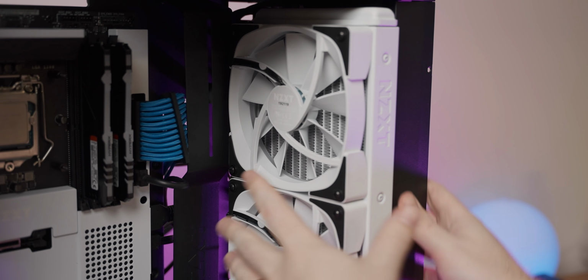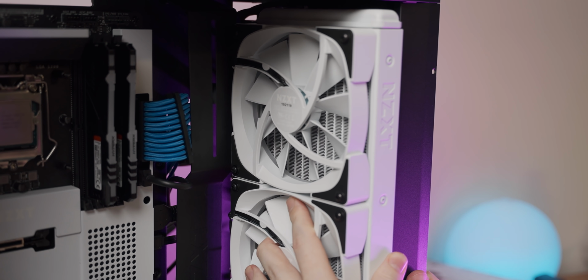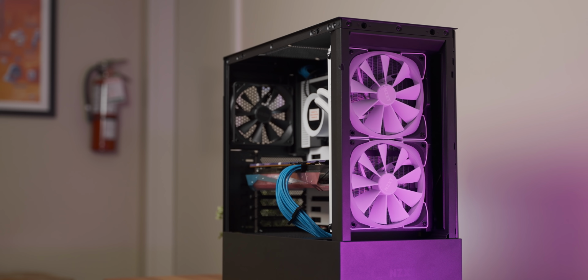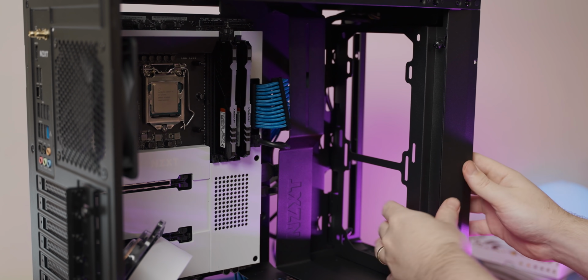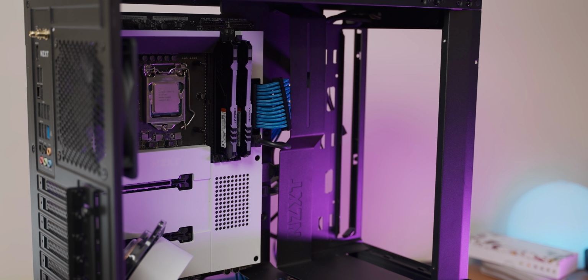and it makes it difficult to maneuver in. And if you have the fans on the same side of the mounting bracket as the radiator, then it's not going to fit in, so you need to move it to the front. On the note of that mounting bracket, I'm really glad that they kept the removable radiator mounting bracket in the case, because it's really nice to use.